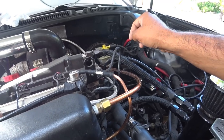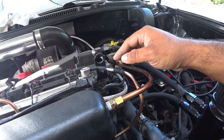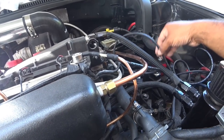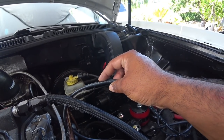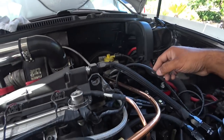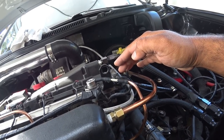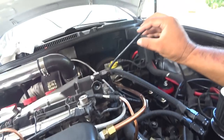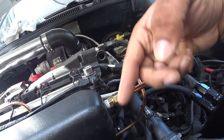The thing you need to realize: go to the auto parts store and buy a couple different sizes. The size I'm using is 4 millimeter — or five and thirty-seconds — they call this washer and vacuum tubing. This is the stuff you need to use to splice into your boost gauge or your air fuel gauge. They're not required to have a check valve on here, so don't worry about that. Splice into it wherever you want to put it.